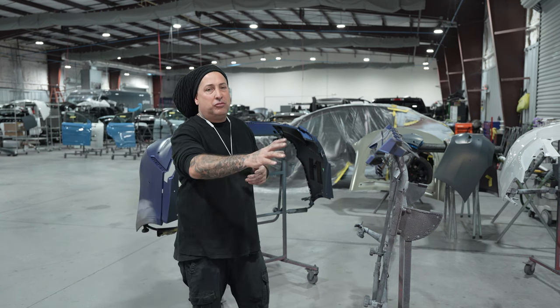All right, so we've got our wet bed on it, and now we're gonna move into the base coat. But you guys know that you always wanna check your color before you start painting. So we did our spray out yesterday before we got this car in the booth. That way, once we get in here, we know what we're able to do. Our color is good, but with the satins, you have to verify which one you're gonna use.